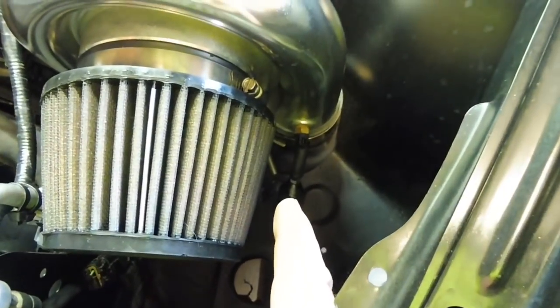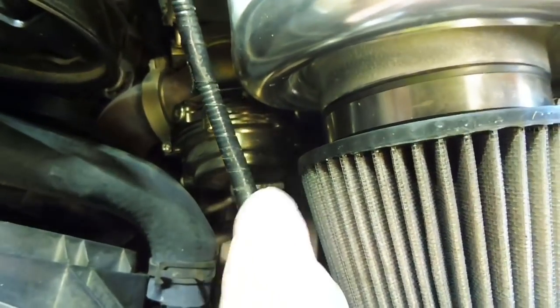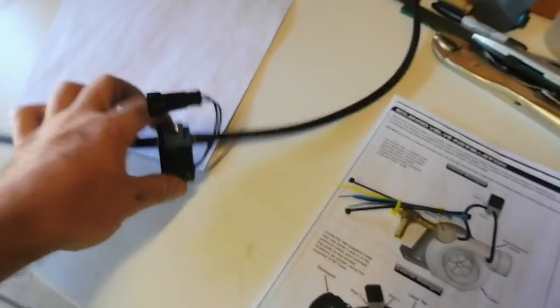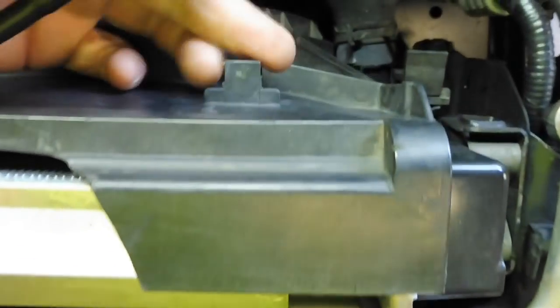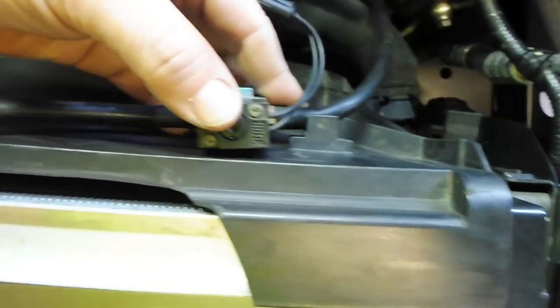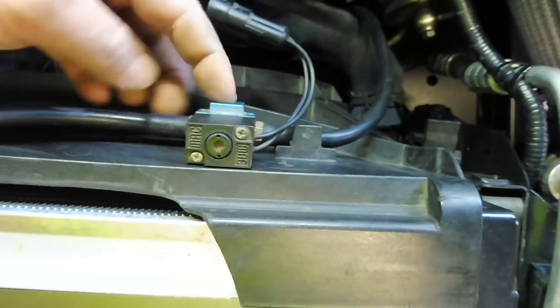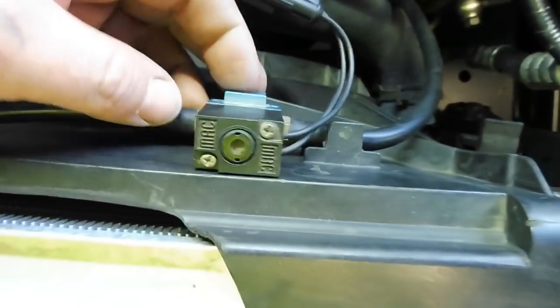So you can see, the light's not great, but there's my bleed valve, there's my turbo, and then the wastegate. There's the top one that at the moment's left open, and there's another one just below it that the vacuum line goes to. I've been playing around with different places to mount it, and there's these old hose clips from when the overflow bottle used to be over here, and I was thinking maybe some double-sided tape behind the valve and just clip that into there.